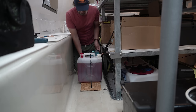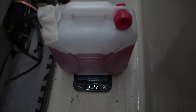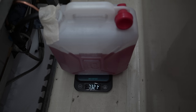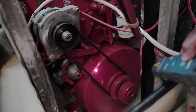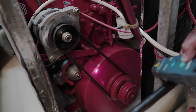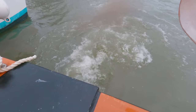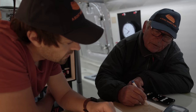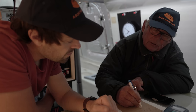The plan was to run the engine via a secondary supply route I've plumbed in for emergencies, like if contaminated fuel renders a filter inoperable, fed by a 10-litre fuel container. Weighing the tank could offer a very accurate idea of what was being burned and how much diesel was being returned from the engine. I've not connected up the tachometer yet, but the handheld laser rev meter was perfect once fired through the front of the engine cowling. It reads a little reflective piece of tape I stuck on the flywheel, and so can calculate the revs per minute accurately. Be careful there's no remnants of tape or white paint elsewhere on the area targeted by the laser, or you'll end up with double or triple the correct numbers. Having checked Alan was securely moored and afloat in enough water, we engaged the propeller. A moving vessel will lessen the load compared to a stationary one having to move the water past it, but useful nonetheless.